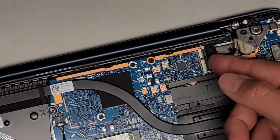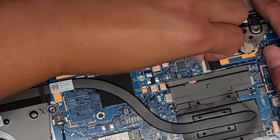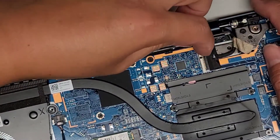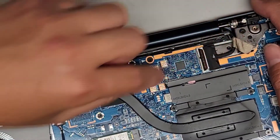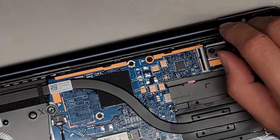It's been about 15 seconds. Let's close this back up. The LCD LVDS connector is right here — flip this latch up to unlock it. There we go — flip that latch up, then you can go ahead and pull this slightly up and pull it out.